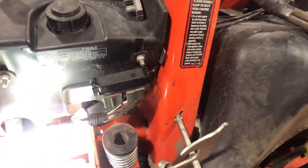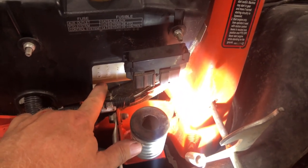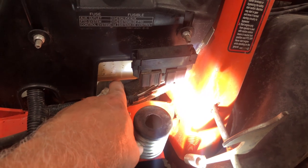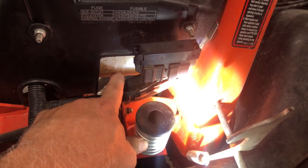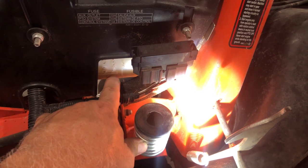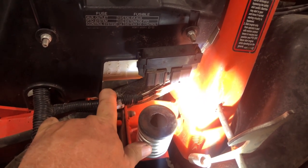In case you didn't know how to top off the fluids — you use this sight glass right here. There are two little lines: one at the very bottom, which is the minimum, and one just above it — about a half inch difference — which is the maximum. You check it when it's cold before you do anything. You don't want it all the way at the very top because as the fluid heats up and cools down it'll move quite a bit.